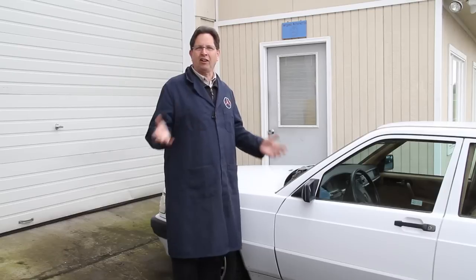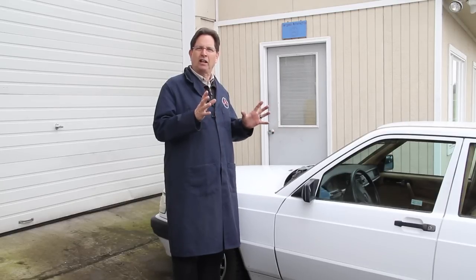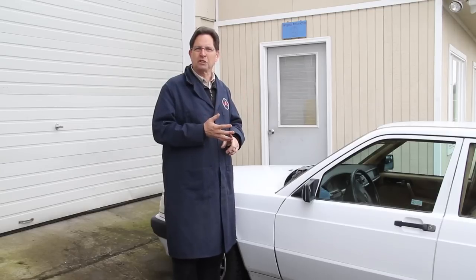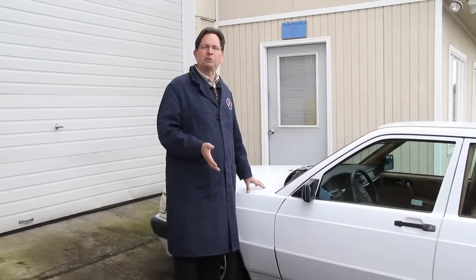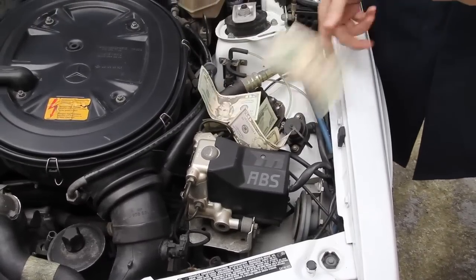If you've done all this and your brakes still aren't working or your ABS light is still on: the ABS light comes on when there's usually some sort of electrical connection problem - either not picking up a sensor speed indication to the ECU or a broken wire somewhere. In my experience, most simple ABS brake problems can be solved by either a brake fluid flush, replacing rotors and pads, or cleaning those sensor wires. The next step would be replacing the front sensors, and then you're into the ECU and modulator unit - you don't even want to think about buying those new. If you're continuing to have problems, take it to a good brake shop to thoroughly test and diagnose the system so you don't end up throwing money at the problem.